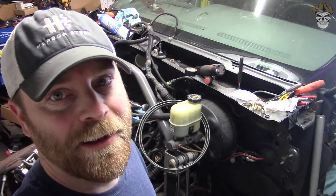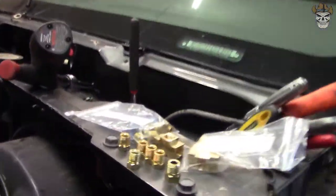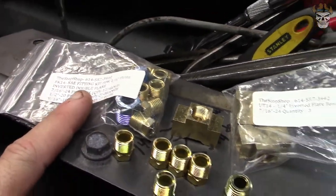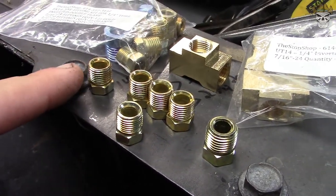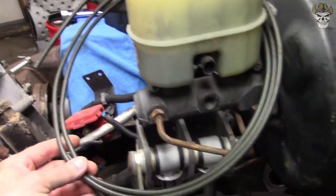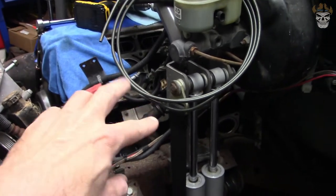It's been a few days and things have escalated — the whole front clip is off the truck and I'm getting ready to do the head gaskets on the motor, but more about that in another video. My tee splitter finally came in from the stop shop, along with some more fittings — all links will be in the description. I got a pack of three pretty cheap. This fitting here is for the master cylinder, these three are for the tee, and these two are for the right and left front brakes. Here's my brake line — let's start running it along this channel, putting it in all the grommets, getting to where the tee is going, and then we'll flare it.